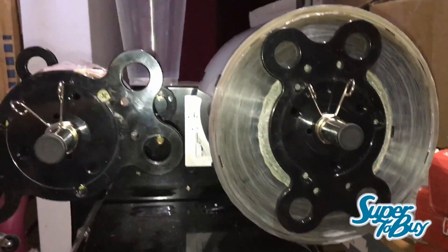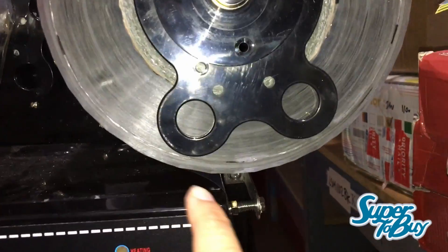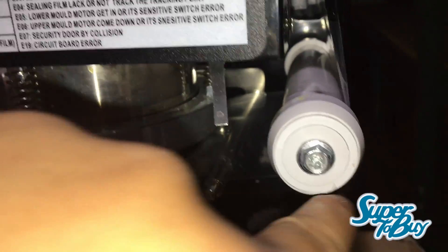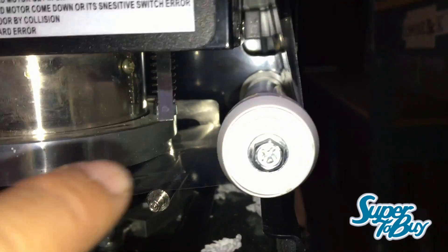Now that you have everything routed, it should look like the one in this photo — that sticker. The roll has to go counterclockwise, going this way, and it has to go through this part right here. Make sure it is touching the black part of the film into that sensor — see how it's turning red? It has to turn red once it matches that little black piece in the sensor. You go over here, make sure you go under here, and over this part — I can't stress that enough.